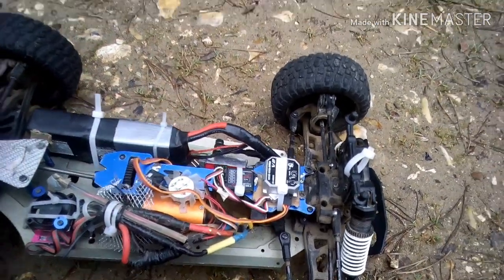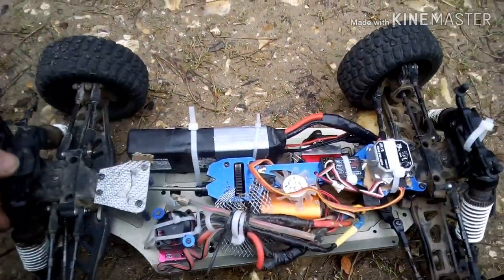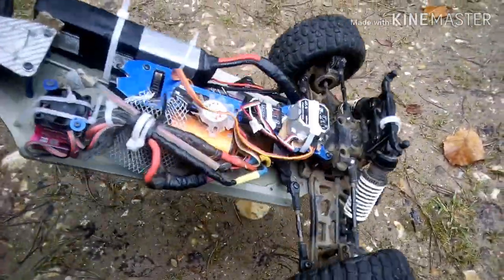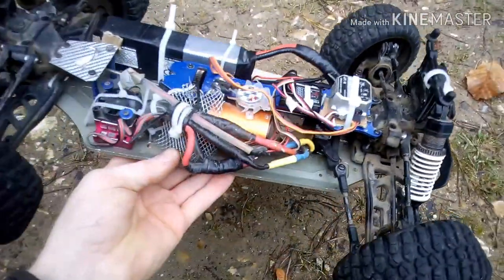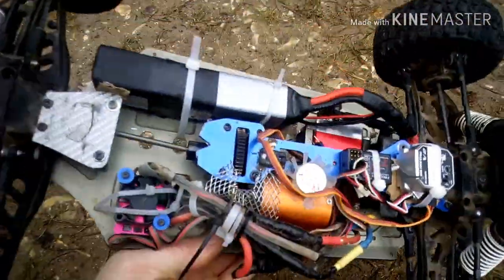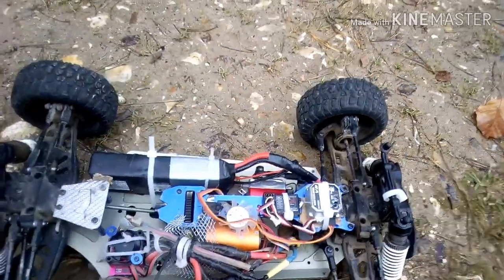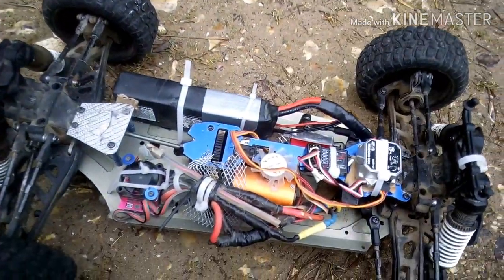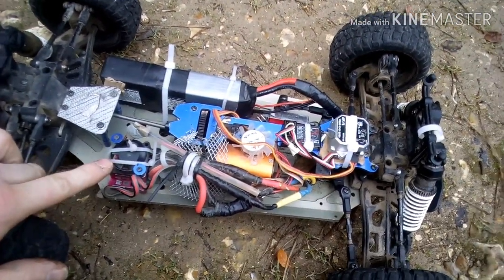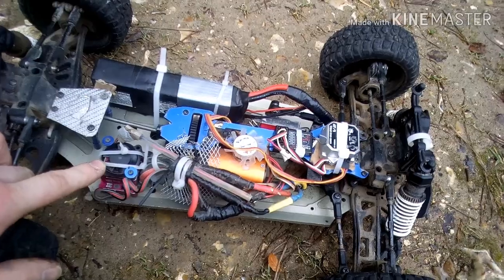We're gonna test this out later on today so I'll let you know how I get on. Bear in mind, because this is so light — the whole thing weighs barely more than a kilo and a bit — because of this lightweight CNC chassis, everything's bolted to that, the top brace has gone and a couple of bits replaced with carbon. It's just so light. I'm hoping that when running it on 3S, this 160 amp brushless ESC is going to provide — well, it is providing — too much power.